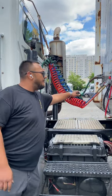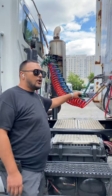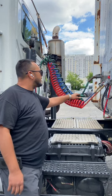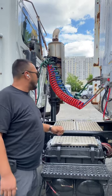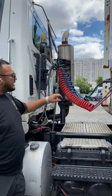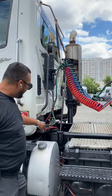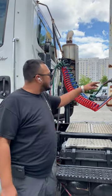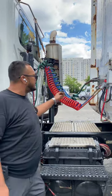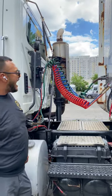Next to it, I have my electrical line. My green or black electrical line has no abrasion, no bulges, no cuts, and it is properly mounted and secure to the socket on my trailer and to the socket on my tractor. Both sockets are properly mounted and secure — not broken, cracked, or damaged. All the mounting bolts are not rusted, not cracked, and none are missing. Both of my safety latches are in the locked position, not broken, not cracked, not damaged.